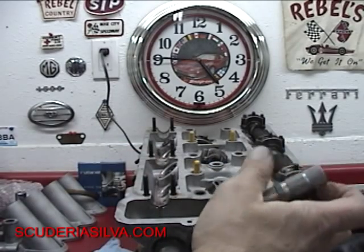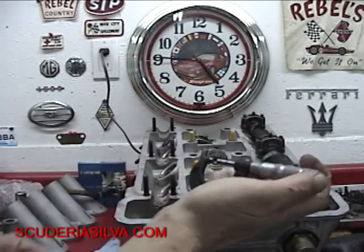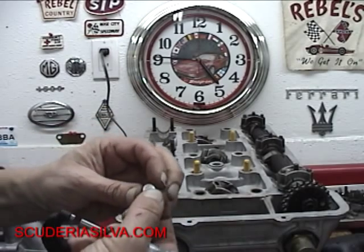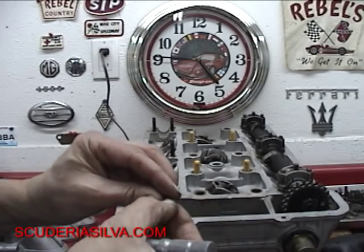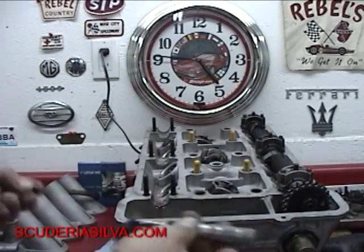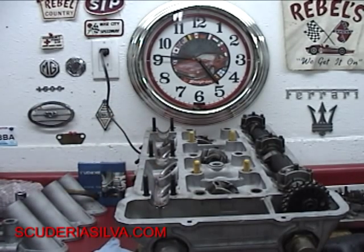The proper use of a micrometer — if you're a machinist — is like this. You hold it with your pinky. Here's one of our shims and we inspect it. We see it's nice and shiny, no wear. It shouldn't have any wear — it just goes up and down. The inside looks great, the surface looks great. So this is number three, and I'm keeping my pucks in order. Number three we said needed to be minus two thousandths.